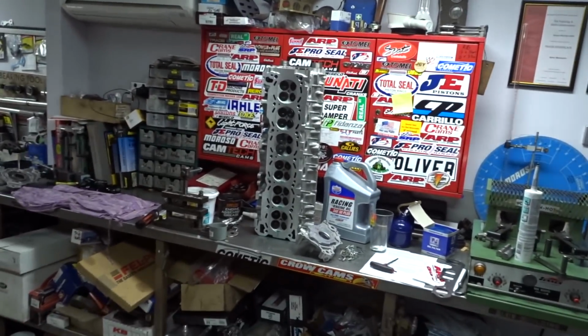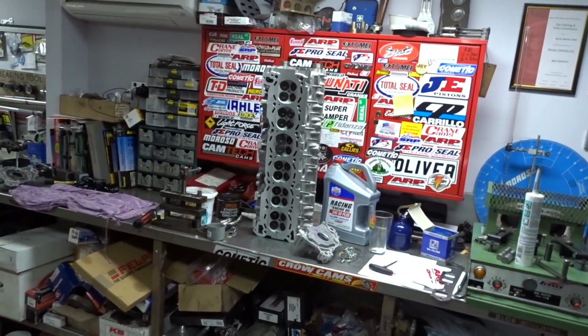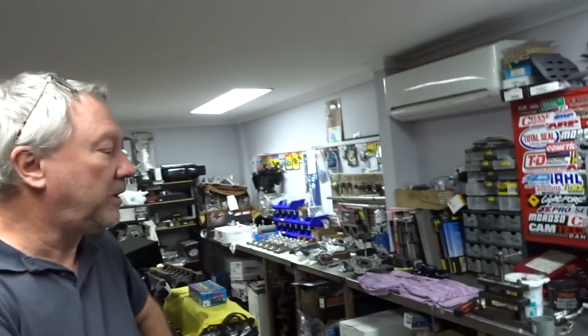It's all valves are sealed now, whereas before it probably would have been 20-25% down. It was 60 psi across all 6. Oh, sorry, that's a lie. The highest one was about 90. That's why we just kept upping the boost. Just keep blasting it in there. It was on 30 pound by the end. Poor old thing. Now you'd be able to run 18.